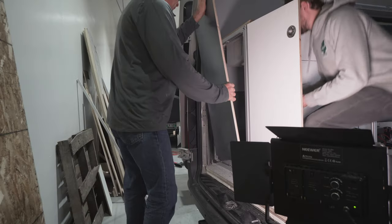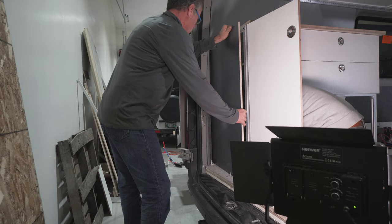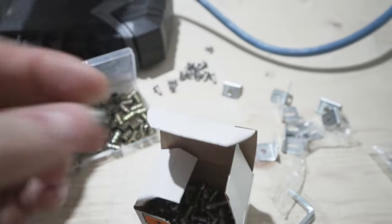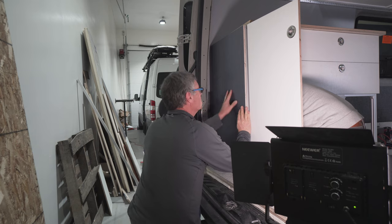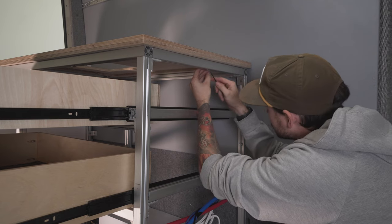After that, the piece is basically ready to go. I'm using these small M4 fasteners — I had to buy fasteners that were less than half an inch, or a little bit more than half an inch, but I had to buy the right size so they would allow everything to tighten up. And basically that's all I'm doing for all of the areas where I'm fastening a wood panel to the 8020 skeleton.